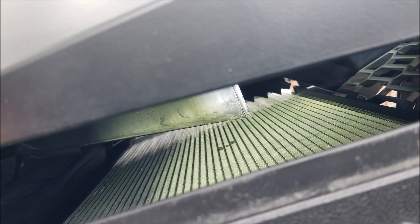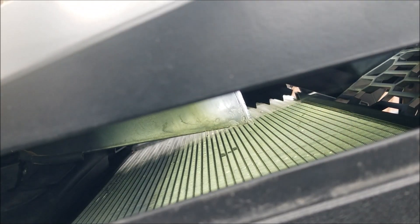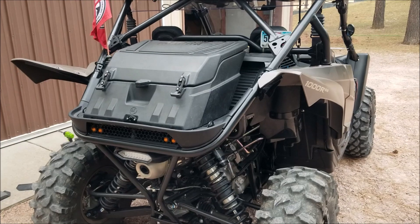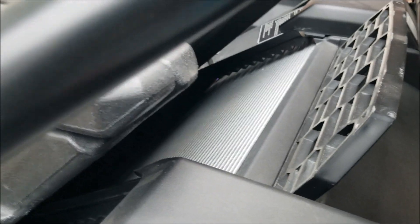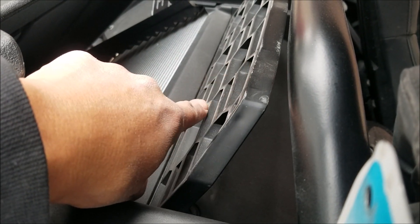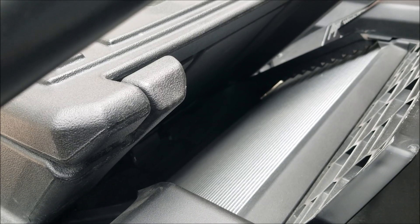Now for a cooling configuration, you have your fans reversed. All your air is being sucked out one end and you get that Venturi effect, versus half your air going this way and half going that way. If you own the stock Yamaha cargo box or even the Tesseract and you remove your shroud, with the shroud removed in the summertime all this heat should go up. You could line this with plastic so the heat goes up and doesn't come into the cab. If you're reversing your fans and want to keep them reversed during summer, remove your radiator shroud — you'll get a lot more consistent cooling and airflow.